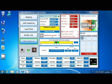We usually provide a small set of error codes that are the target of this feature, even if some software customizations have their own. However, the selected error codes that we put inside are usually false positive errors. I mean conditions that are detected as errors by the petrol ECU while we are on gas, but we know for sure that are not errors at all. Okay? However, let's have a try.